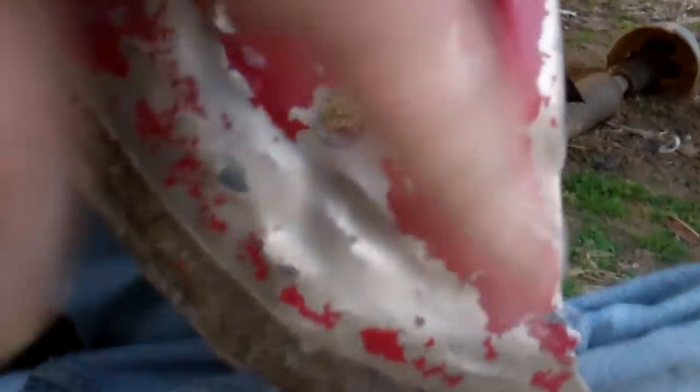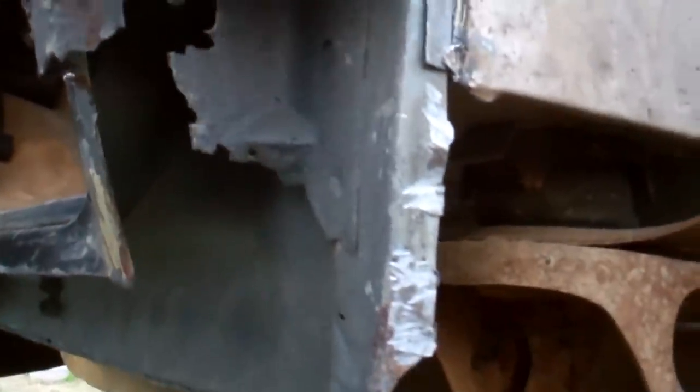Of course I'm gonna have to come down this - I'm gonna take it down, I'm gonna have to cut down right through here so that it will line up with this outer edge of the seam here where the spot welds are.